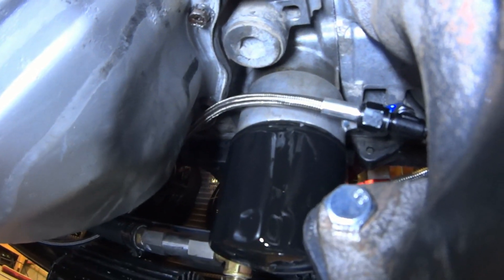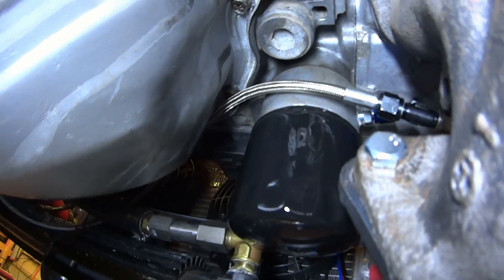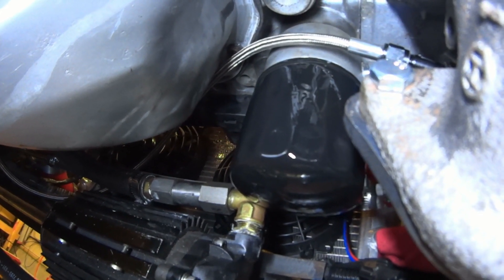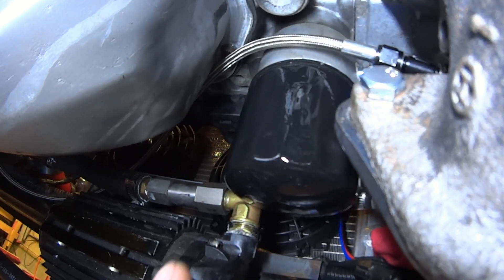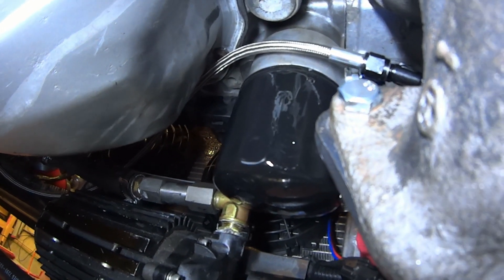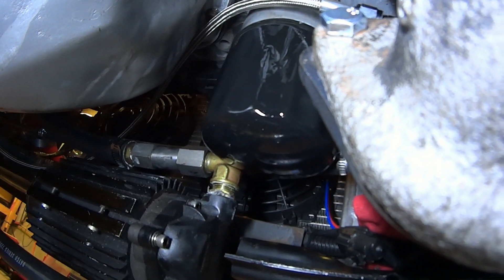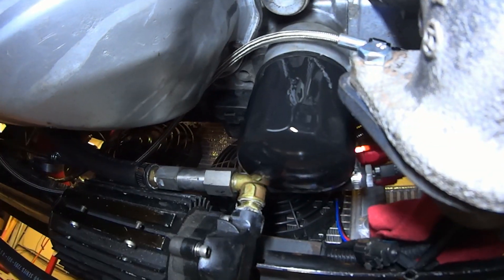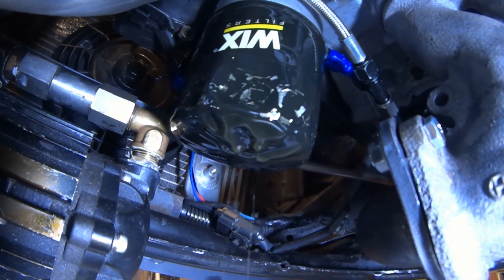So what that tells me is I didn't really pay very good attention and I don't really know where this sandwich adapter came from. This oil filter is for the SVX but it does not appear to match this sandwich adapter. I'm pretty sure Foresters from around 2004 came with this sandwich adapter from the factory or maybe it was an add-on. If I compare the two oil filters, the outside diameter of this one is 3.15 inches, and if you look at a Subaru Forester 2004 XT — which is the turbo model — that oil filter is 2.68 inches. That's probably why I'm getting oil pouring all over the ground. So if you're going to try to retain the SVX oil filter, that type of sandwich adapter is not for you. I sacrificed this oil filter and learned no matter how hard you tighten it, it still won't work.